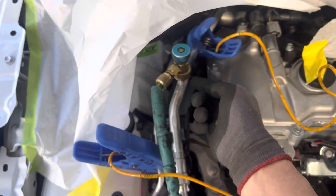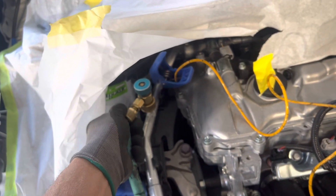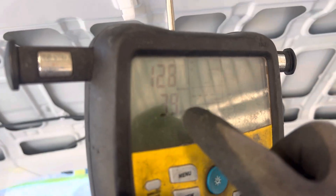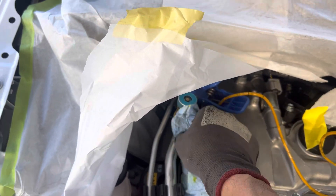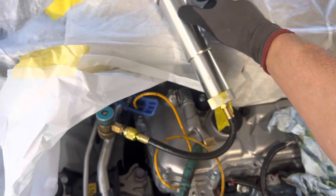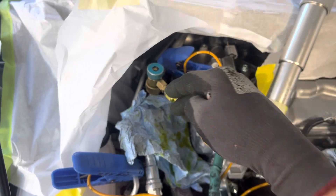We're unscrewing the fitting so it's not depressed, because we're going to inject the oil right down through here. Because the system is open, it doesn't suck air in since it's at 120 microns. Let's hook it up. Now hooked up — grab it, turn it upright. Now as I go down here I'm depressing the valve, so now I can inject the oil in.